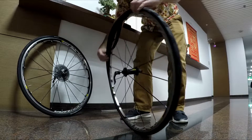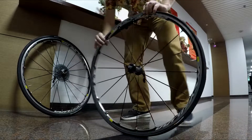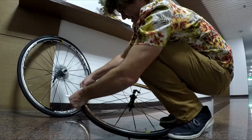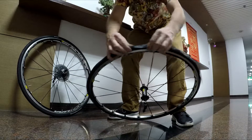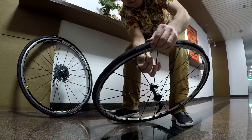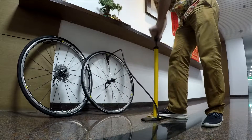The last little part is always the hardest. This is where you'll have to use your levers, but use your hands as much as possible. Work it up to the end, always making sure the tube isn't getting pinched, and flip it on. One last thing: go all the way around the tire, rolling it back and forth and pushing that valve up a little to make sure it's not pinching the rim. Work yourself all around the entire tire.